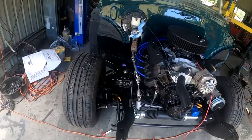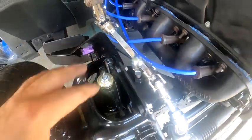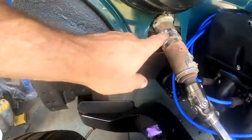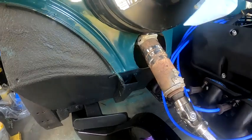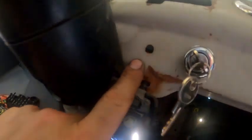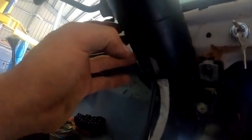I've got the steering column set up where I want it to sit. I've adjusted the length of the D-shaft and made it a little bit further on. I trimmed the original firewall plate off because it wasn't going to work, and re-drilled the holes for the column to bolt to the dash. There's no support behind the dash, so I'm going to make some stabilizer brackets to go from the dash back to the stabilizer brackets I made for the pedal box on both sides, in nice thick steel to support the steering column.